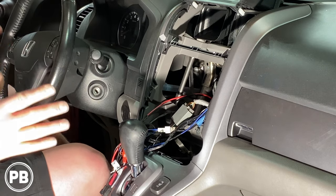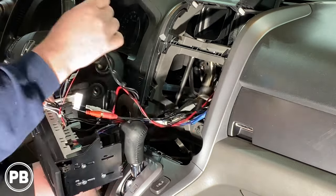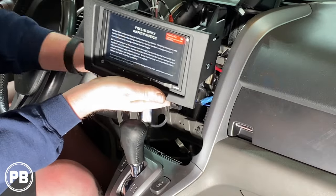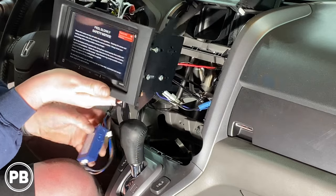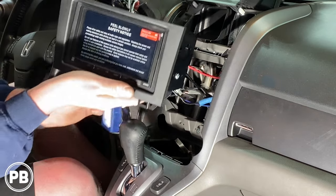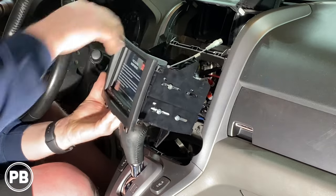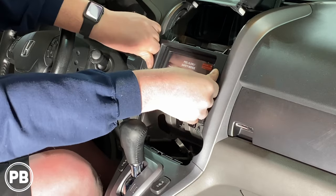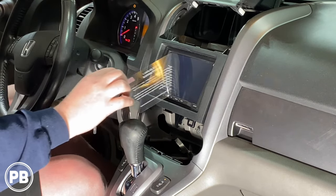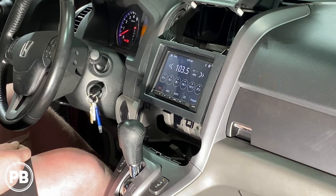Back in the car, we are finally ready to start assembling our new radio in the dash. We've made all our connections and we're tucking everything down into the dash. We've already pre-programmed our steering wheel volume control module by going to PAC Audio online — we'll link that in the description in case you want to know how to wire and program it. Let's double check everything's working before we totally get it in there. Everything seems to be working great — let's go ahead and finish reassembling the radio.